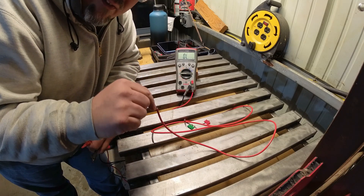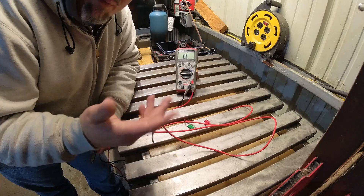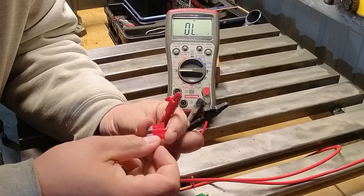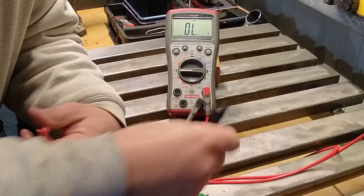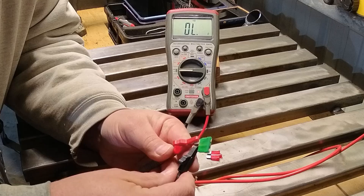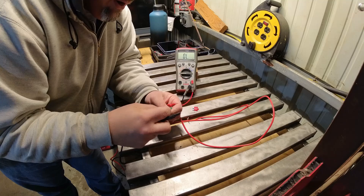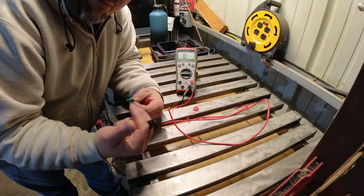The reason you would test a wire is that automakers use things called fusible links. Those burn up and power is not moved from one end to the other — it's basically a fuse in wire form that burns slower. You can also verify whether a fuse is good or bad. If the visual cue isn't there, or the break can be so fine you can't see it, probe one to one side — connected, great. A bad one will show OL, which means open loop, meaning that fuse is legitimately bad. On the top of fuses there are often two little test ports, so you can use the probes and touch the fuse in the fuse block to verify it's good or bad without pulling it out.